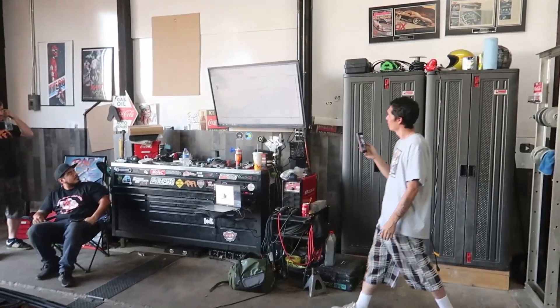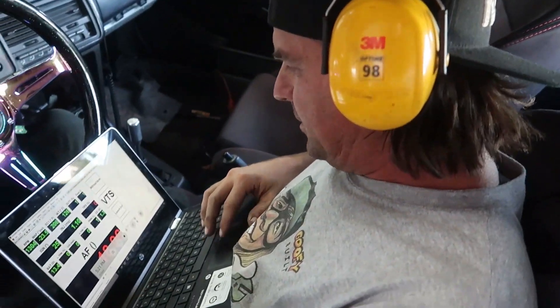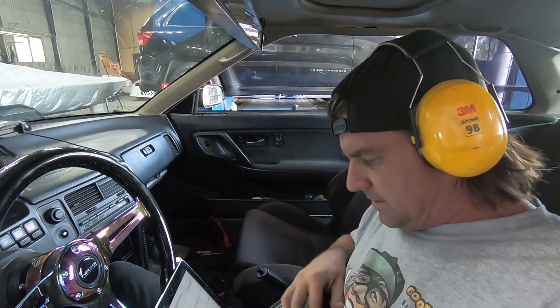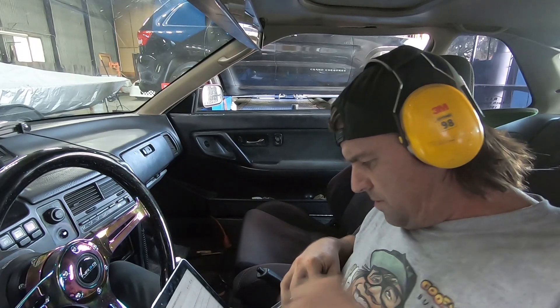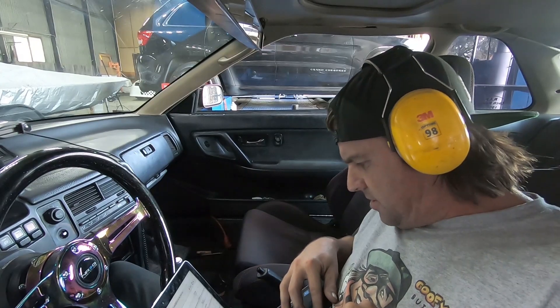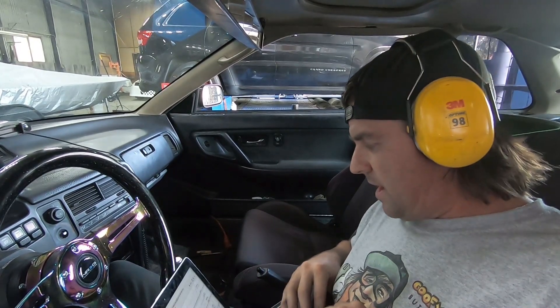That one has the right curve. There was one little misfire in the middle — everything else looked really good. It's time to lean it out. At a high of 21 pounds right there, it still ramped in kind of hard and then came back down around 19, with 18.5 at the very tip. Pretty much what we're after. I left it at 6.25 — he's going to go home and enjoy the crap out of it. What a rad little ride.